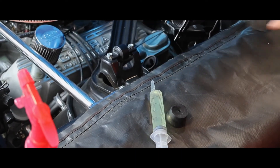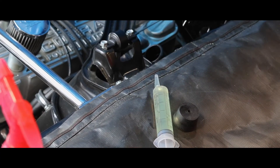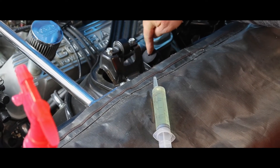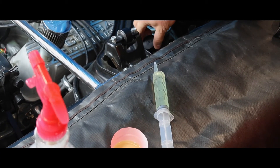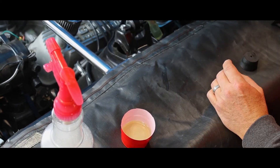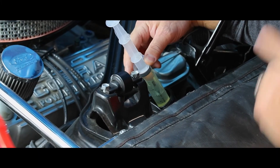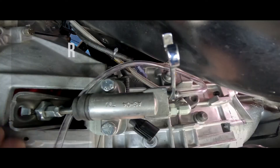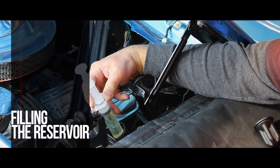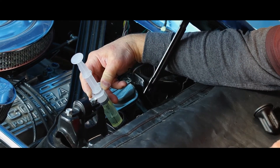Remove your cap. Some reservoirs do not have bladders — this one does. Make sure not to drip any brake fluid anywhere. Optionally, you can install a beaker stopper into the top of the reservoir and put the syringe directly into the hole in the beaker stopper. The preferred method is to put the syringe directly into the reservoir as shown. You will have to locate the syringe to the center so that it will be in the port for the reservoir hose, then plunger down. We're going down to the bottom of the vehicle to open up our bleed screw, then plunger down in a single swift stroke with the plunger centered directly into the reservoir port. Make sure you press firmly down to hold the syringe in place so the fluid does not backwash into the reservoir.